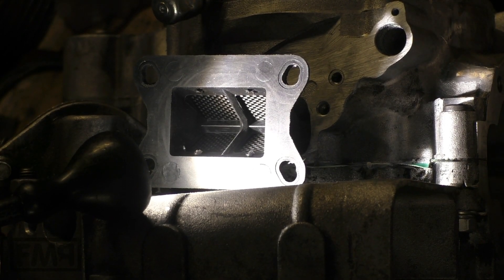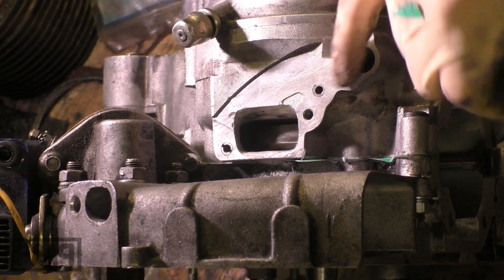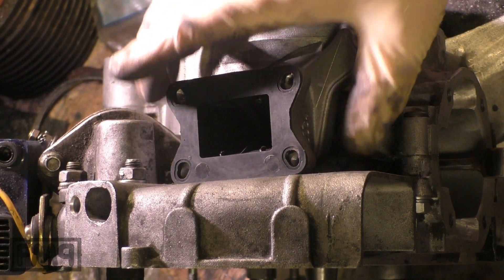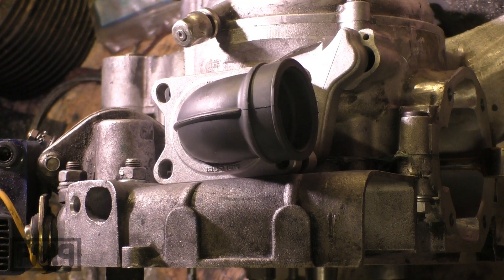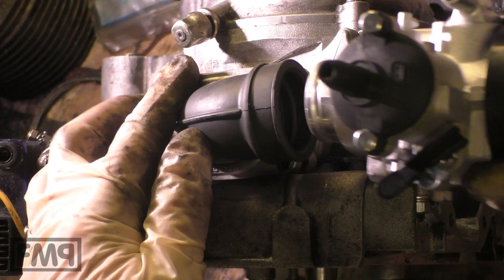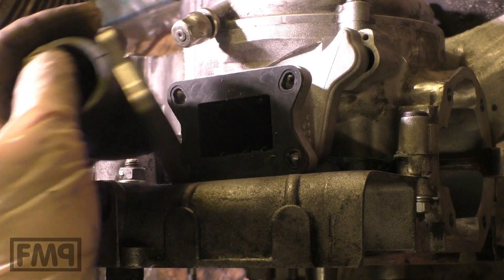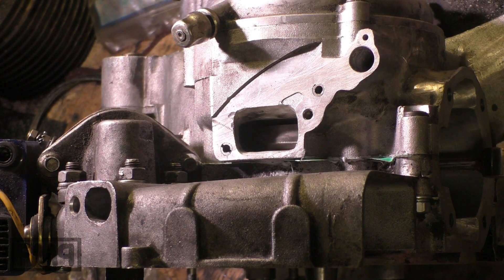It's not two parts like the rotary valve — it is one part. We have a manifold, we have the reeds sitting in here, then we have the nozzle, and there the big carburetor sits. In this case it's going to be 30mm. The lower door sits here. Nozzle, reed, manifold, and the crankcase.